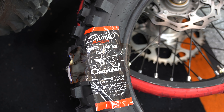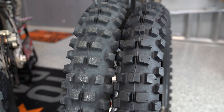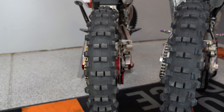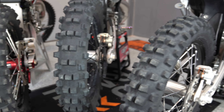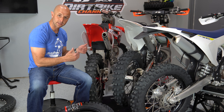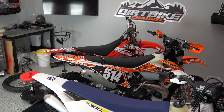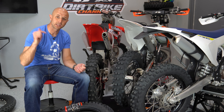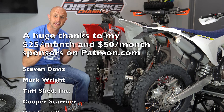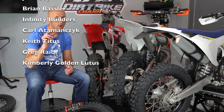So yes — the Shinko 505 cheaters are very, very good. They're great for rocky and hard pack stuff, the summer months in the Rocky Mountains. They're not so good in the sand and mud. The 525 is definitely better for sandier, looser, muddier conditions. The 505 is the most closely related to a trials tire and it's great for enduro riding. The 525 is coming closer to the motocross style with more of a knobbier pattern. I buy all these tires from Rocky Mountain ATV — please use the links in the description to buy from Rocky Mountain ATV or Amazon. It won't cost you anything but it'll help me out a ton.